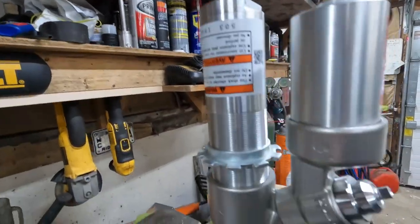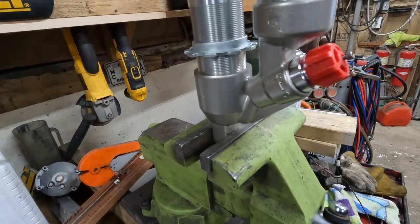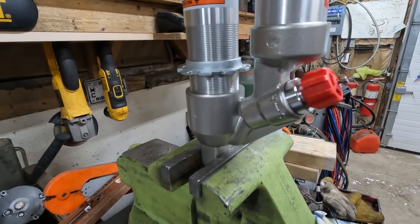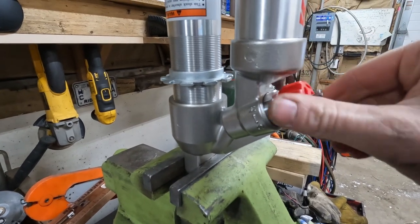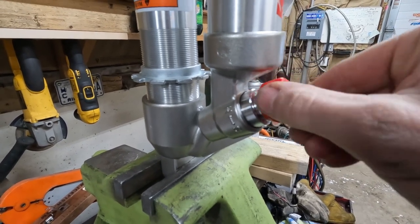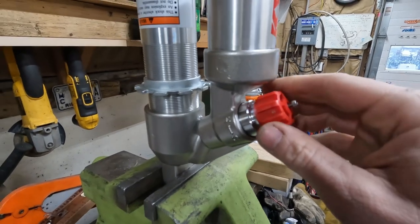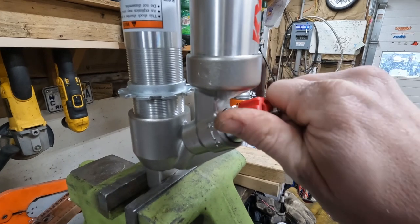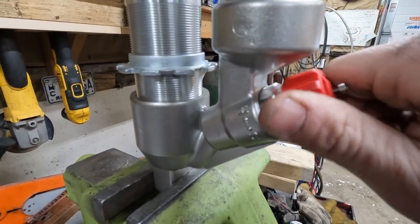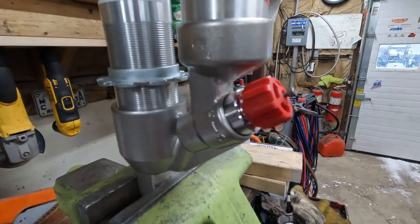Here's the new one — shiny. We were fifteen from full soft, so we'll back it off to full soft and count back up. That came set at thirteen from the factory, so we were pretty close. Counting up: one, two, three, four, five, six, seven, eight, nine, ten, eleven, twelve, thirteen, fourteen, fifteen. Beautiful. Now let's tighten her back up.